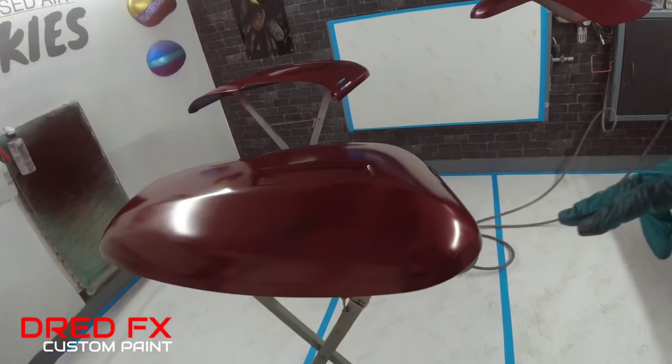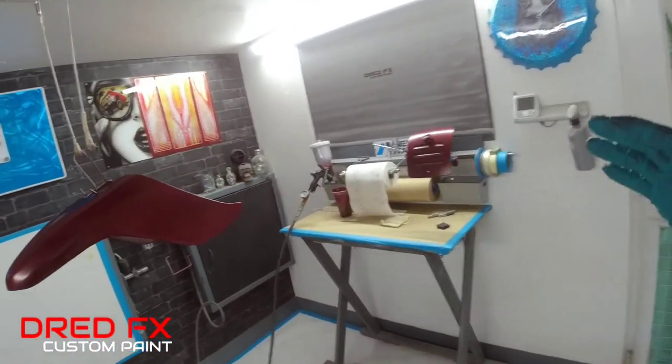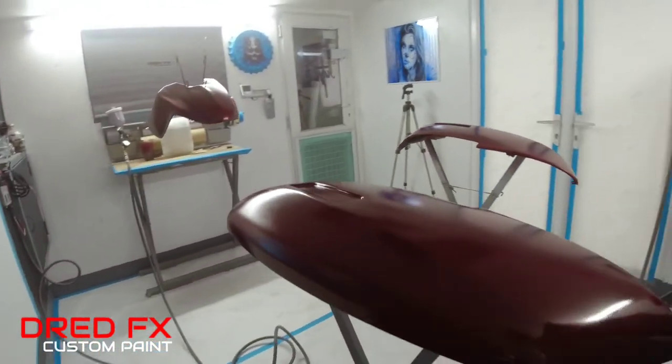So we've got the next coat down, still not got full coverage — we're still seeing through. I'm just taking my time letting these dry down between each coat, then just build it up. They're going down okay. If you go too heavy too quick with solvents, you can get all sorts of troubles. So just let this flash off. Got the heat turned up — I'm going to grab a coffee, let this cure down and then we'll drop the next coat on.